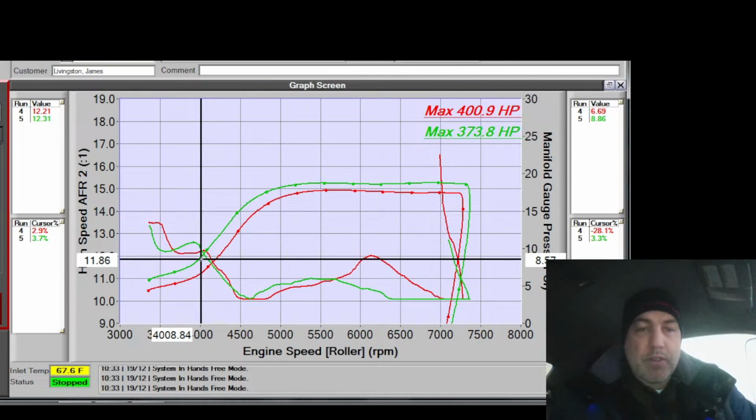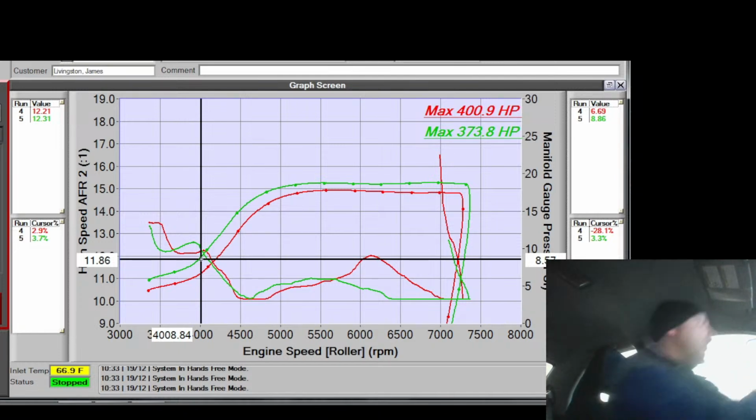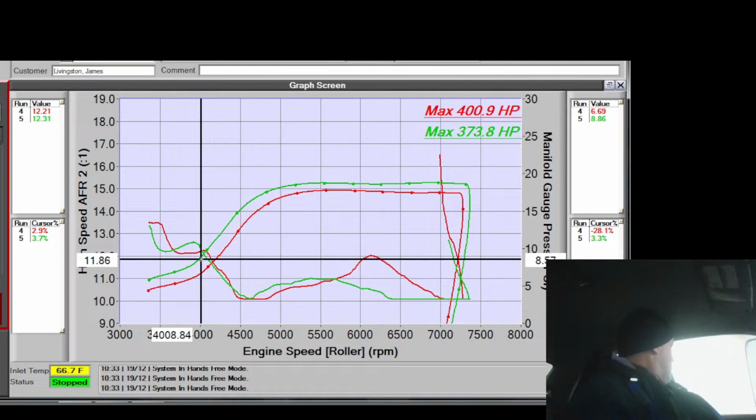I wonder if this MAP sensor calibration is wrong. I mean, I got it right from Cobb. It's the brand new Cobb 4-bar. Okay, I'm gonna rev it at idle here. Actually, I might load it a smidge, slow it down from revving, and see where the MAP goes. Where's my actual absolutes? Right there. Yeah, see, it goes to 14.2. That is higher than we are today.